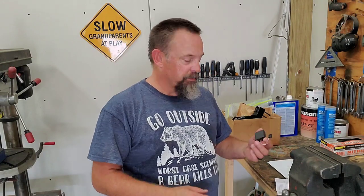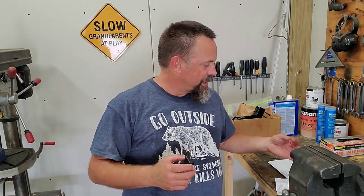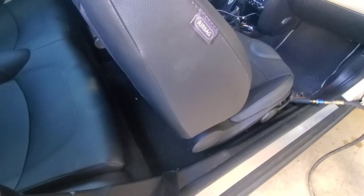On eBay they sell a kit where you can bypass the sensor. It essentially plugs in place of the sensor underneath the seat and tricks the computer into thinking somebody's in the seat, makes the warning light go off, and it also bypasses the seat belt switch. Now you can't put a child in the front seat because this essentially makes the airbag active all the time — so if you crash, that airbag will go off because it thinks somebody's in that seat. First step is to remove the seat.